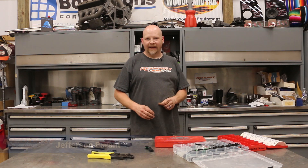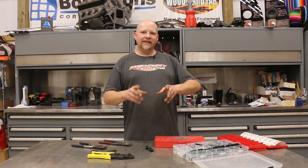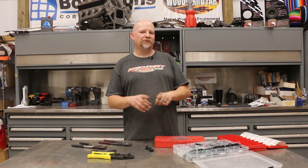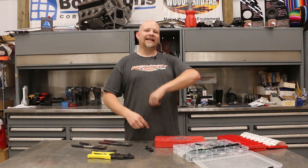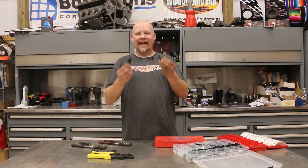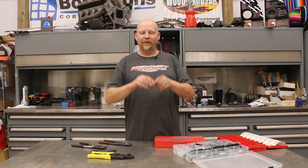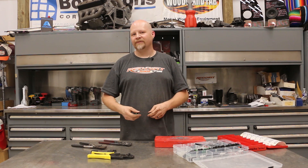Hey guys, thanks for tuning in to Red Dirt Rods. Today we're going to do some wiring tech. We have my '71 Buick GS convertible over on the lift, and I'm putting in a new transmission controller for our TCI Super Street Fighter 4L60. Because this has an LT engine in it, I need to split the speedometer sensor signal to send it to both the ECM and the TCM. To make this more feasible for R&R when we have to service things, I'm going to add a weather pack terminal to the transmission speed sensor so that we can split it, because those wires are on opposite sides of the vehicle.